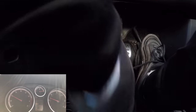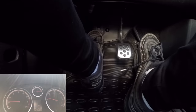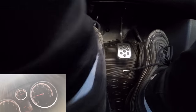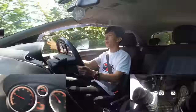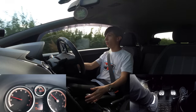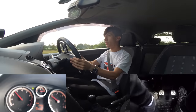By doing this it makes the downshifting so much smoother. Here is how other people would change: put the clutch in, a little bit on the accelerator — it's a fairly smooth gear change, but you don't hear anything, especially if you've got a nice exhaust on the car. With an air filter it's brilliant. If you didn't rev match you would literally be breaking your neck. So we are going to come up to a junction right now and downshift, probably to second.